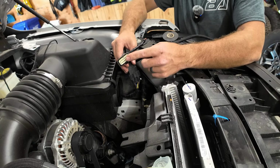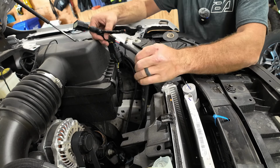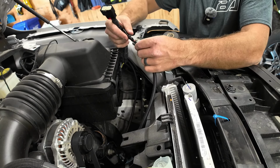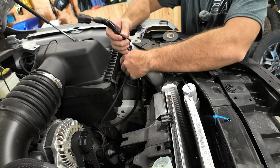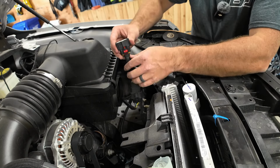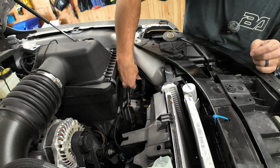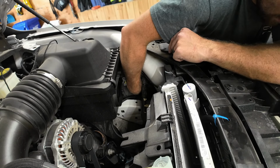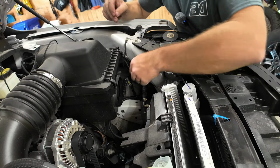And then this guy here is gonna plug into the back of the headlight. This wire here that we threw in the engine bay a minute ago has to plug into this little tail coming off that harness. So that's plugged in now. Now we can plug this into the back of our headlight. And there's a little red pin on these things right here. Once you get this harness clipped in, you just gotta push this pin down to lock it. If you're not as familiar and you need to actually visualize it, then you can go through the back of the wheel well liner. So there, clicked in, and I locked the red pin in.